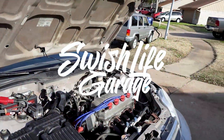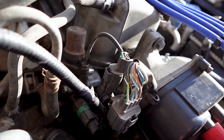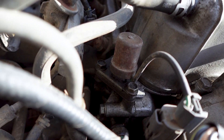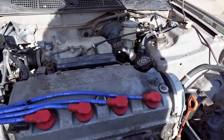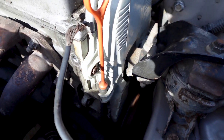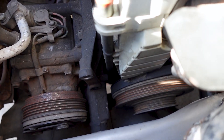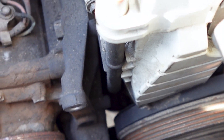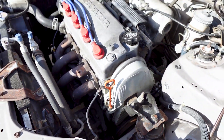Today just doing some little things. I got to fix the gasket for the VTEC solenoid — it's getting a little bit moist around there, so definitely got to change out that gasket and the o-rings. I want to change out the dipstick because it's definitely leaking down there. It's definitely getting moist down there and some oil going down to the oil pan.